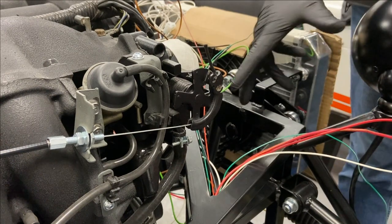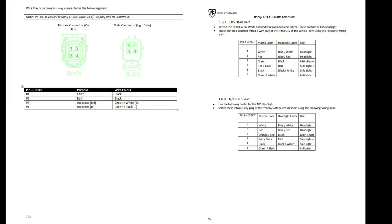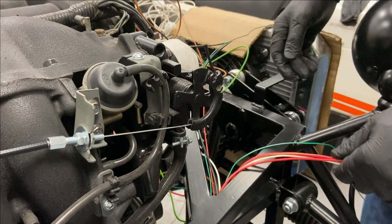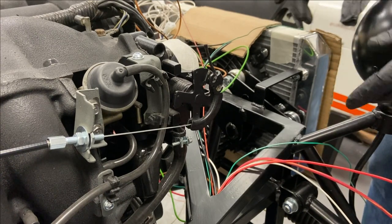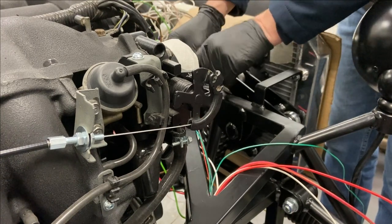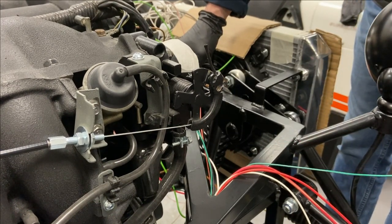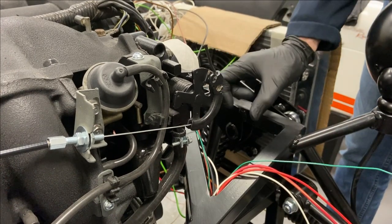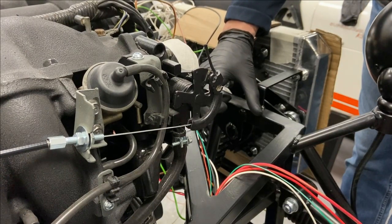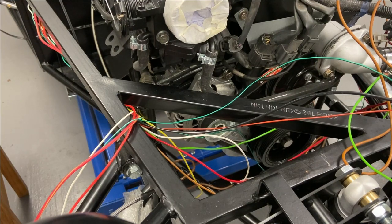What I'm going to do is put a six-way connector in here. In the manual I've just updated it, there are certain pin numbers and I'll flash up the pin number wiring on screen. I'm going to wire this to the pin numbers - it's going to make our lives really easy. If everybody wires to the pin numbers in the manual, on both sides it's going to be incredibly easy to debug in future. I've also got an earth here going to a multi-joint, and I need an earth for the indicator and for the headlight sidelight. I'm going to put a six-way plug here and a four-way plug up here for the nose cone indicators.